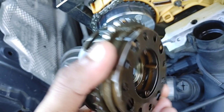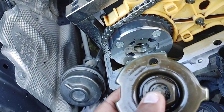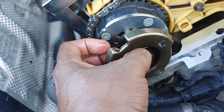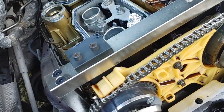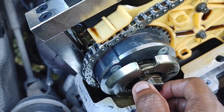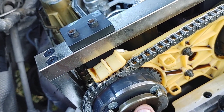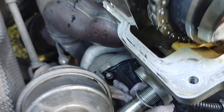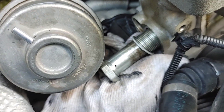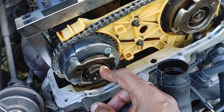The old unit has been taken out and the new one has been inserted. Now to get the valve bolt back in place — you'll screw it in just enough for it to hold. When it's snug enough, you're going to re-tighten the tensioner, which is 80Nm, using the same 24mm socket. I'm going to tighten the Vanos bolt to 55Nm and then 55 degrees.